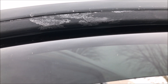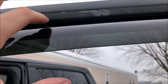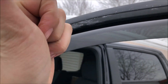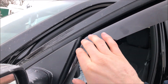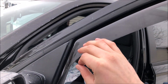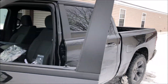There is a smaller secondary seal right here — you can see it's folded, then goes normal again, then folded again. I'm going to take a small flat blade screwdriver and go between the visor and that seal to get it pulled out to the correct side. It was tucked too hard and I couldn't get it out without risking breaking something, so I ended up pulling the whole vent back off. Being more careful starting from this corner going up, if you don't pinch that small weather stripping at the same time, it actually goes in quite a bit easier. There we go — driver side installed.